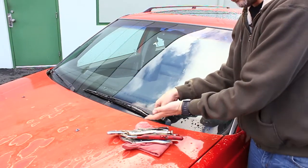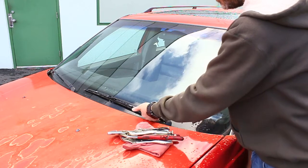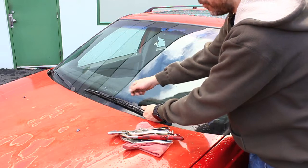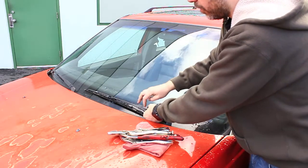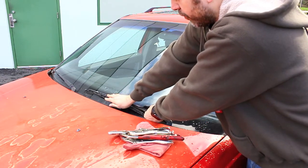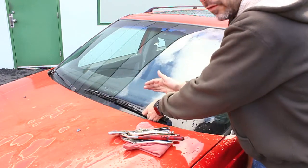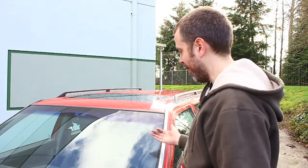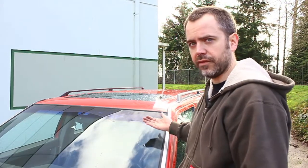To achieve this, I'll start really rudimentary. Hold the base steady and push the arm part down — use one hand to pull up slightly on the base while you push down on the arm to bend it down in comparison. It's not a perfect art; it's a matter of giving it some muscle until you can feel it give a little bit, then stopping to check. You're not going to get it perfect the first time, so do it a little bit, get the windshield wet, turn the wipers on, watch the travel and the swept area to see if it's still lifting. Ease into it and by the time you get it going the right way, you're pretty much good.